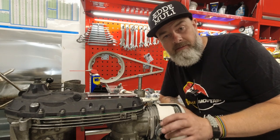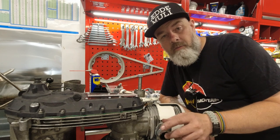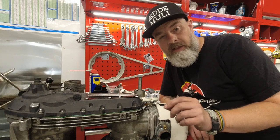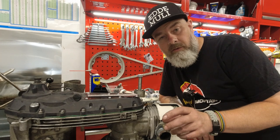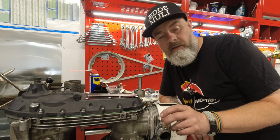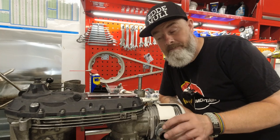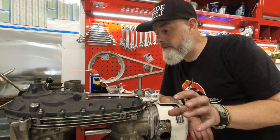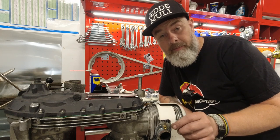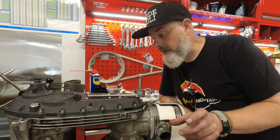Number two: if you are fitting an Li SX type kickstart ramp - which is the recommended one, not the DL - you will also need the kickstart ramp, the three special screws for that, and the skinny washers. It also does not come with a breather, so you'll need to source one. Apart from the breather, you also need a magnetic drain plug.